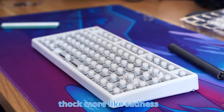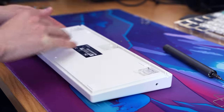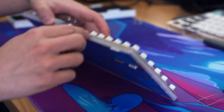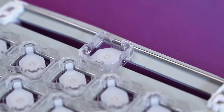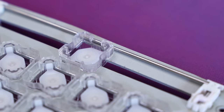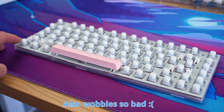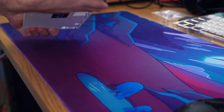I got frustrated, smacked it around, and opened it back up again. At first I thought it was a problem with the actual stabilizers, so I did a lot of fiddling. I didn't know it was the plate yet. Imagine me rinse and repeating, opening and closing the case with trial and error for about two hours. How I ended up fixing this was I took pliers in between that little gap in the plate and just straightened it out. That ticking is horrible — I've troubleshot it a lot and it's really hard to get it to go away. I'm gonna have to swap the stabilizers at some point. It also gave my plate quite a bit of warp, but it's sealed back up.